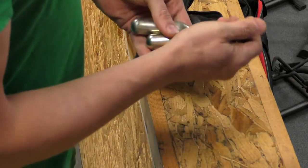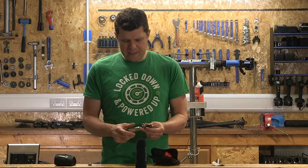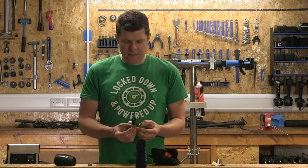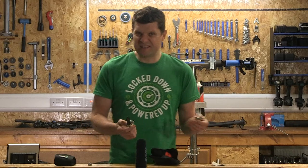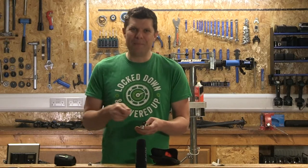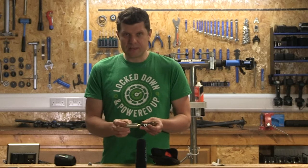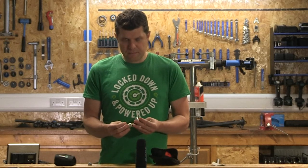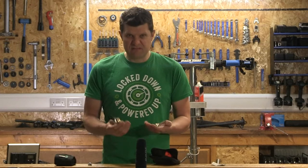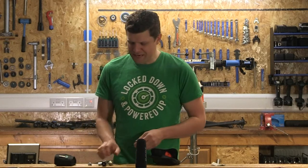I like to carry CO2 gas on my road bike. I run tubeless but that doesn't really matter — just two gas canisters and a cylinder. I tend to use one lightly attached, not piercing the thing. To get anywhere near the sort of pressure you want in most road bike tires you kind of want one of these. I'm now running about 60 PSI, so two canisters gives you probably three or four shots. How often do you get bad punctures on a road bike? Touchwood, it hasn't let me down so far.